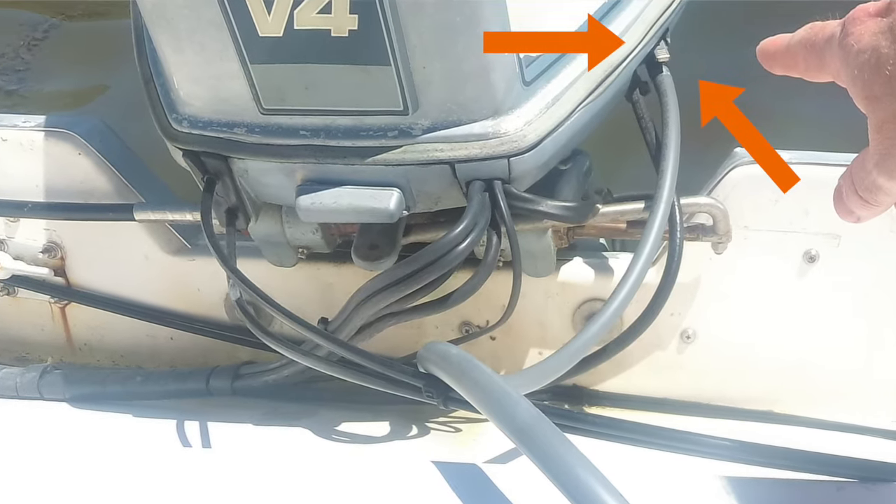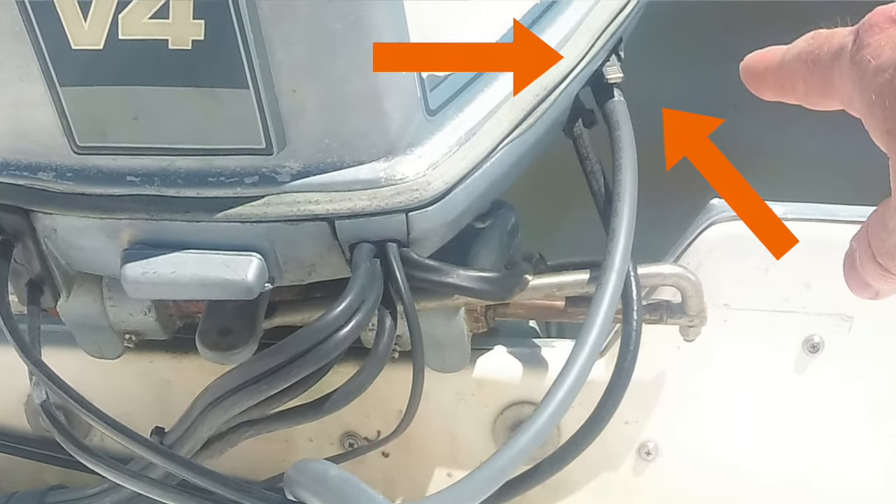After you've sprayed for a couple of seconds, disconnect the fuel line from the engine — that's the hose with the pumper bulb on it where it connects by the cowl. There's a metal clip — just pop that clip and pull it off. After you pull that off, the engine will only run for a little while because there's still some gas in the carburetors. While that's happening, continue to spray fogging oil through all of the intakes, lightly spraying until the engine shuts off. When the engine shuts off, you've run all of the gas out of the carburetors, so they are clean and dry, and you now have fogging oil through all of your pistons, intakes, and combustion chambers. Go and turn off the key — you've now fogged your engine.